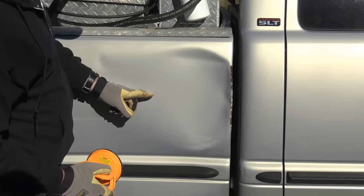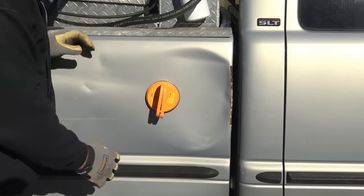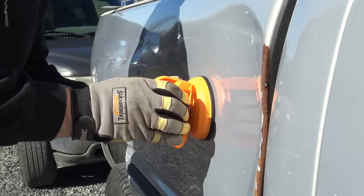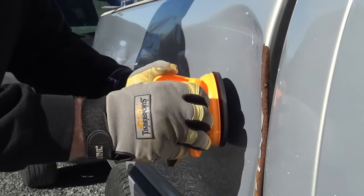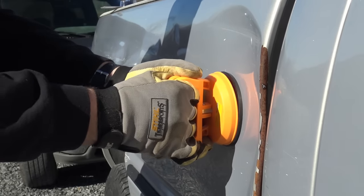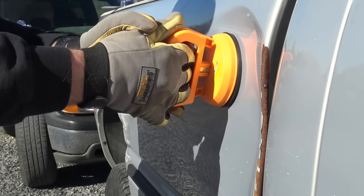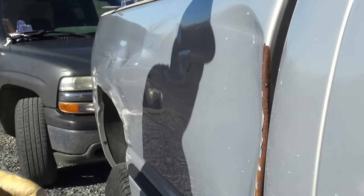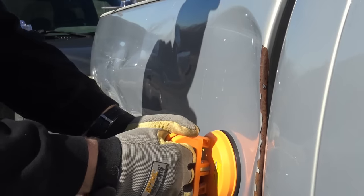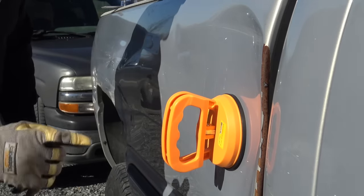Basically this little suction cup clamps down and draws tight. We're gonna install the clamp, mash it against there, pull it snug and tight — it's holding pretty good. We give her a tug. It pulled it out a little bit. It slides a little but we didn't pull any paint, so that's good. There's a nice crease right here so I'm not sure it's gonna fully work, but it's definitely pulling the dent out a little bit. This is our test — I think we're gonna go on over to Red Beaver's truck.